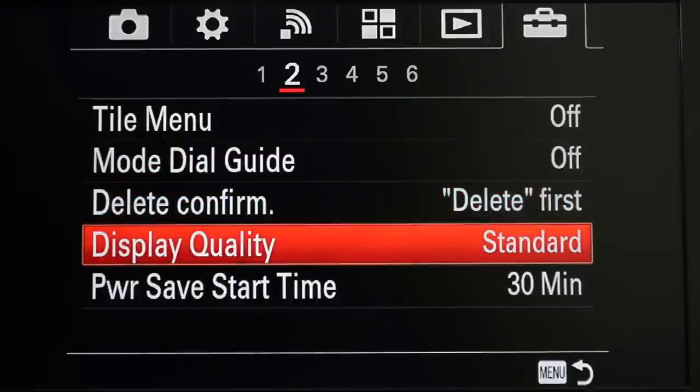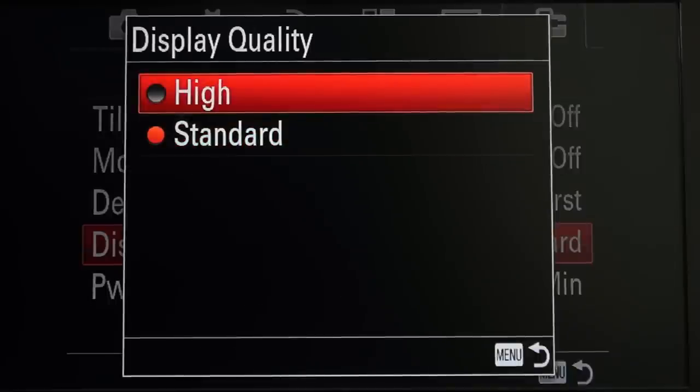If you go to the menus — it's in the suitcase menu, submenu two — display quality: Standard and High. What does this do? You look through your camera and can't see any difference on either the LCD screen or the EVF. High quality is actually taking more pixels from the sensor and feeding it to your live view display. The LCD is such low resolution you really can't see the difference; the EVF has higher resolution so you can see a little more difference, but only if you're looking at something very high in detail. I took my trusty multimeter and measured the power consumption in both modes — High takes up 20% more power than Standard and it doesn't look 20% better. I would keep this setting set to Standard and move on with your life.